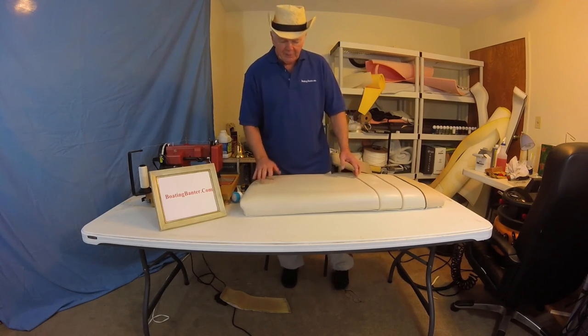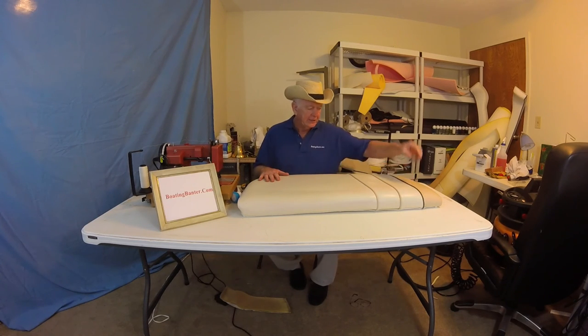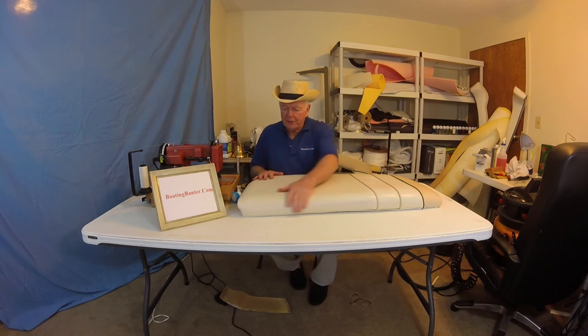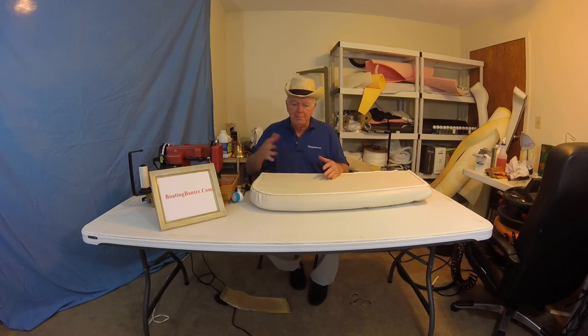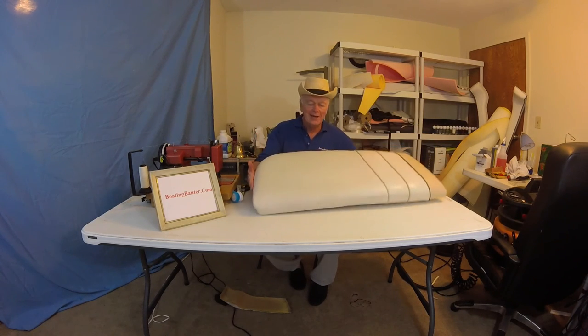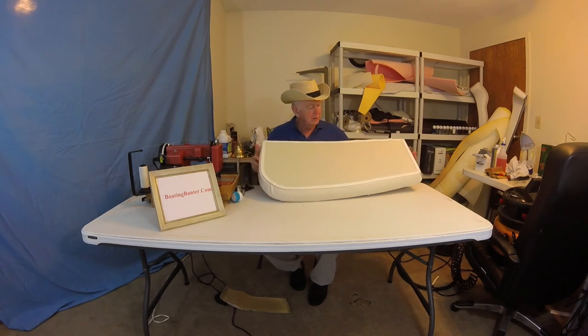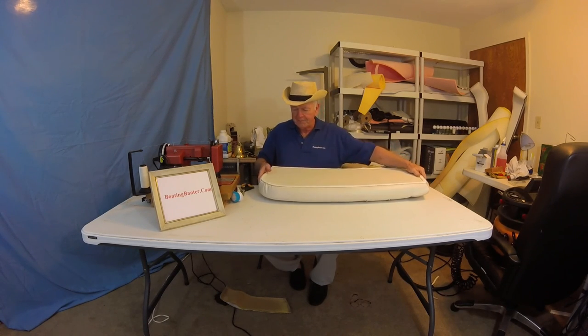The foam was in good shape. The one thing I want to bring up though is the hold-down strip right here. All you do is put that in first, then staple it in. I had to put it on this way. The good news and bad news with redoing things like this is that all of the vinyl you leave on there is already pre-measured and pre-curved to go around the sides. Well, it makes it nice but makes it a little harder to get on. So I tacked the hold-down strip, put this end on first, and just pulled it up and over. Here's the back — that looks pretty good. A little bumpy in a couple of spots, but that's from the piping going over. Can't do anything about that. Looks good.